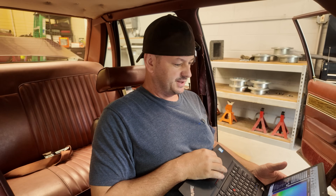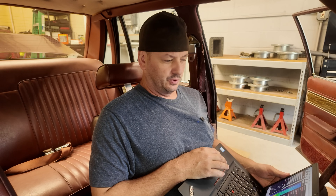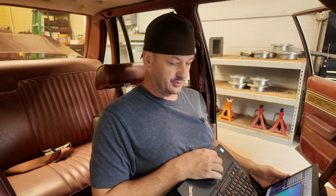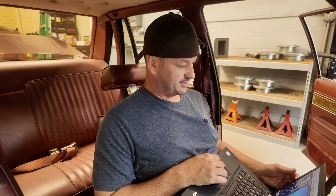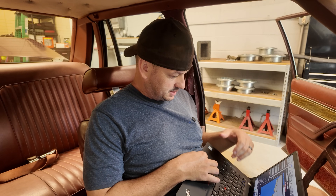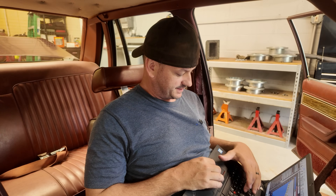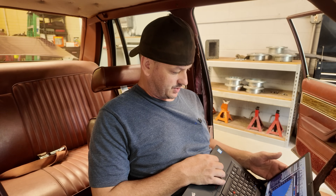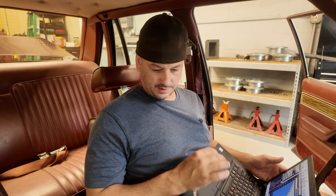Good news is all of our inputs and outputs, sensors, and all of that stuff is set up. The bad news is the fuel and timing tables had to be redone from scratch. This is a new computer, first car doing it, and I haven't switched any of my old files over, so we're going to have to do this one legitimately from scratch. I haven't even started it yet. Even though I used his base file with all the setup, I've still gone through and modified basically everything. Messing with the IAC parked position right now. All right, let's see if it'll run.